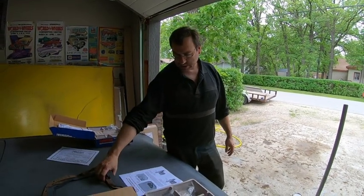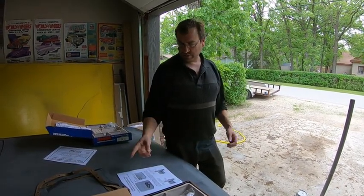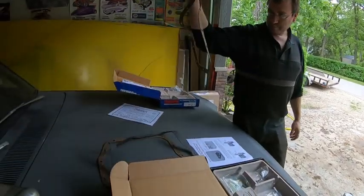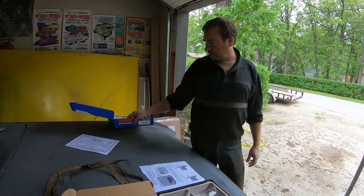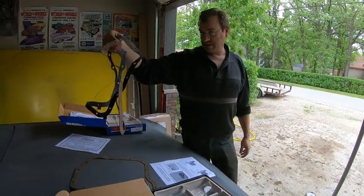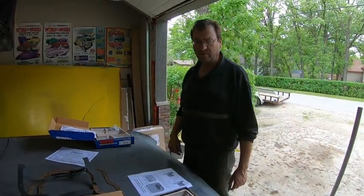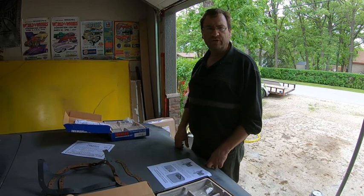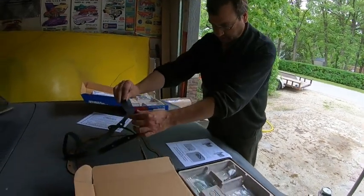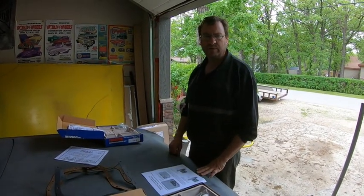The one problem is usually these kits are a generic kit for a 904 and a 727. This one only came with a 727 gasket with the lump. His old kit, we found two gaskets and they're both 727, so we might have to go find a 904 gasket, or see if the old one from this transmission, if it's a cork gasket, might be usable. But we'll figure that out once we get the pan off and everything.